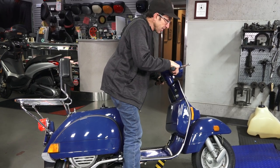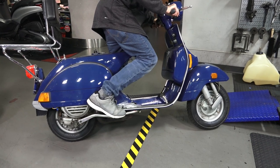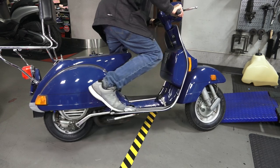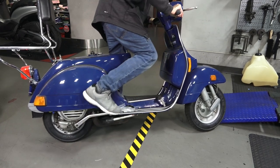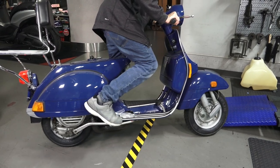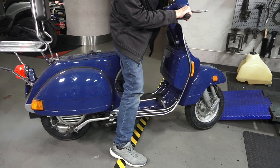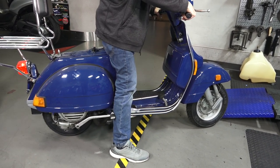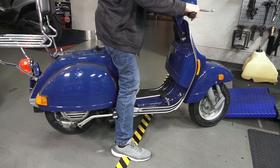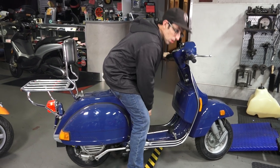Let's do the magic trick. Let's tip it to the left — full throttle, no choke. Should turn the fuel off and give it some swift kicks. It's pretty flooded. Let's turn the fuel off this time.